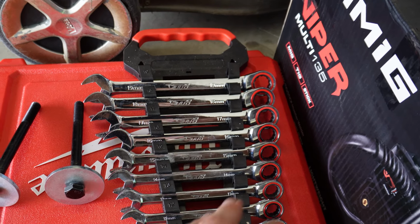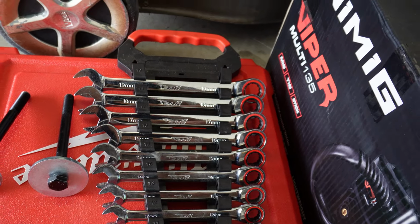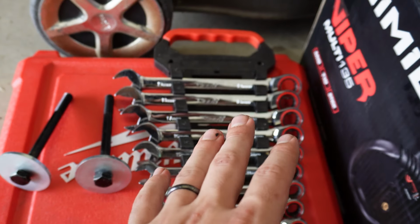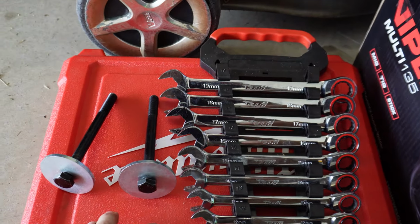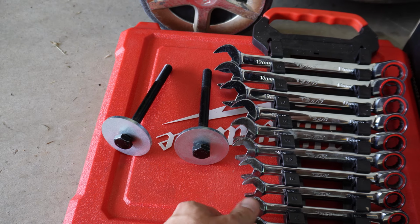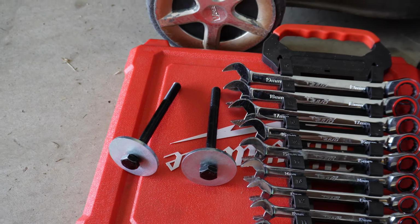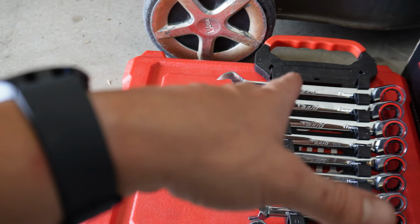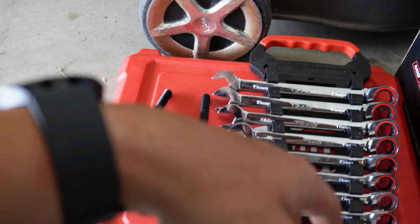I also definitely recommend a good rattle gun or impact driver or something like that that can give you a good amount of torque, so you can do up all them bolts nice and tight, and probably get yourself a thinner impact socket set. The Milwaukee one is good, but like I said, the flared back ends of them made it a bit difficult to get to some of the bolts that were through the midsection of the bar. So I definitely recommend getting yourself a good set that is thin and doesn't have a flared end on it.